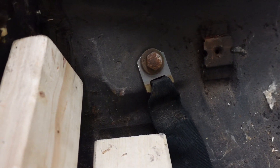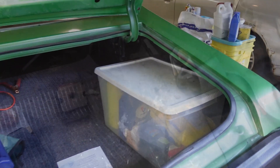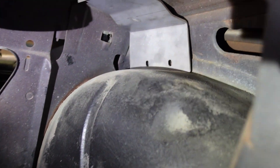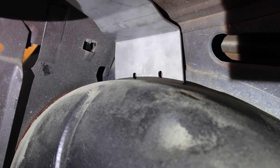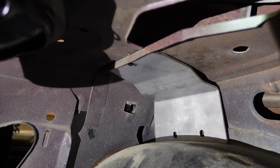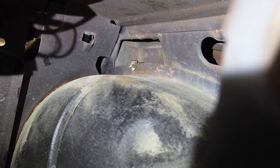We're going to be replacing these floor belts with the ones from the kit. I'll keep the nicest belt for the center and then get these installed. On the passenger side I've got the passenger bracket in there - you can see how it's angled. That bottom left hole lines up with the hole that's already in the pinch weld. You're going to bolt that one in, then drill a hole here and one up there, and it tells you which size holes to drill.